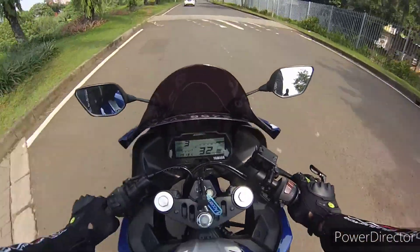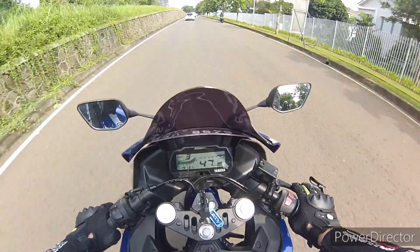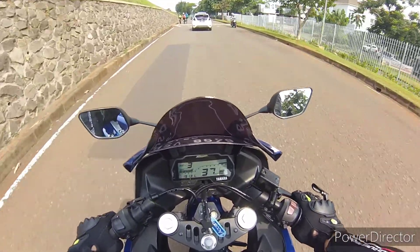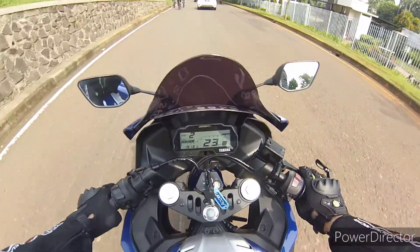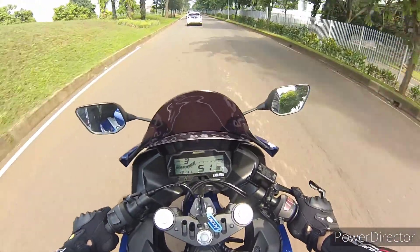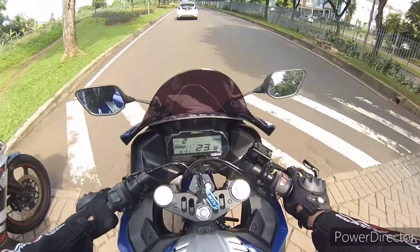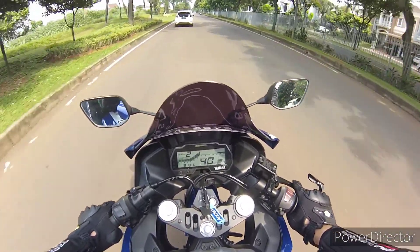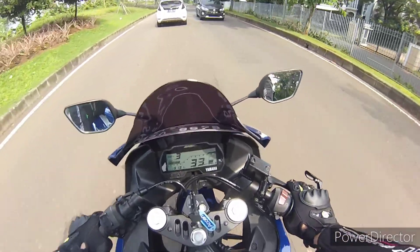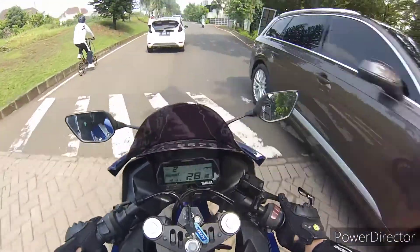The GSX-R Air has heavy bottom-end pull and really fills up at the top — long breath. So the GSX-R Air feels already like a two-stroke, although it's not as powerful as a two-stroke. The character of the GSX-R Air is similar to two-stroke — heavy bottom pull, wild top-end. This one is different because it's SOHC with a square engine. The bottom pull is okay because of SOHC, and the top-end which should be heavy is helped by VVA, so it fills up reasonably.